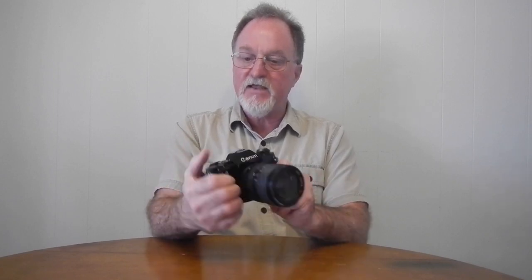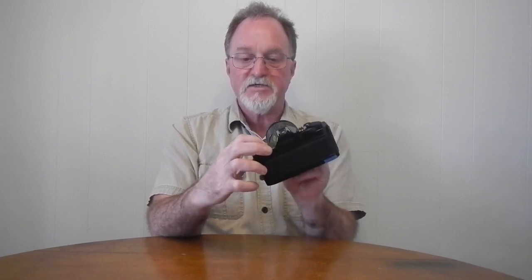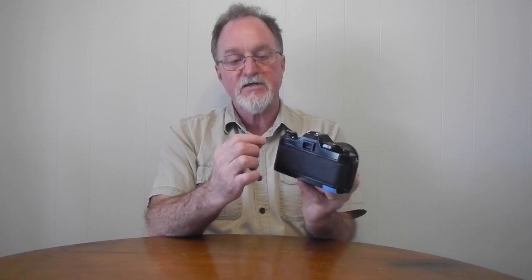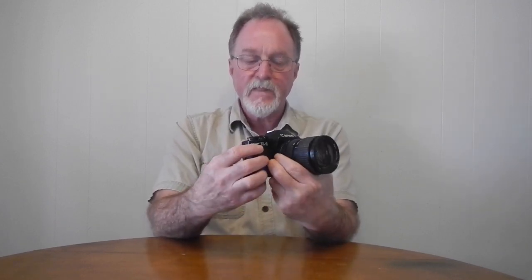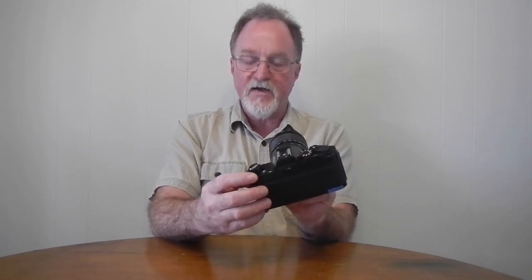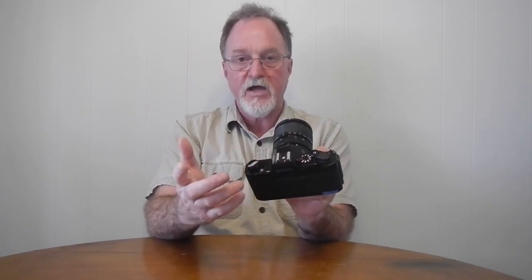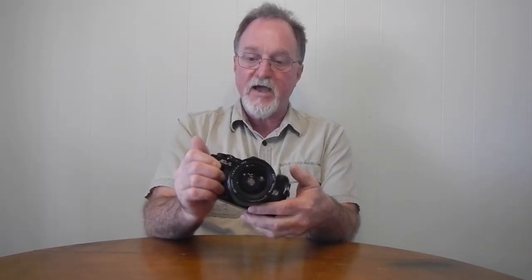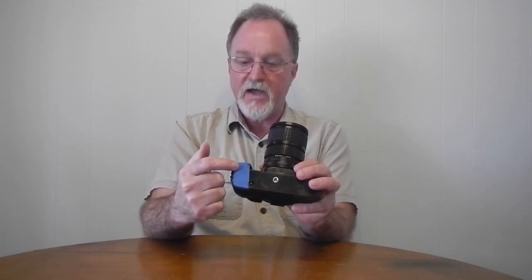This camera does need batteries even for the manually selected speeds, because all shutter timing is electronic. You need to set your film speed by pushing this little button to enable it, then spinning the dial just underneath the rewind knob — settable from 25 to 1600. This little button is a battery check; there's no light, just if your needle jumps up, your batteries are working. On the subject of batteries — good and bad — it uses AAAs, really common batteries. That's great.